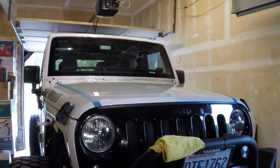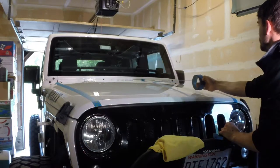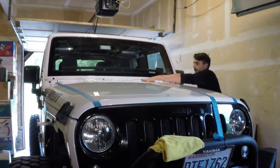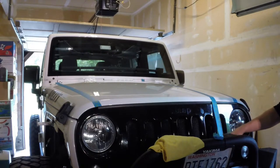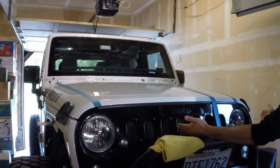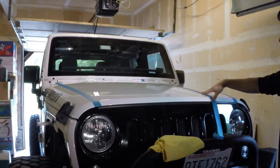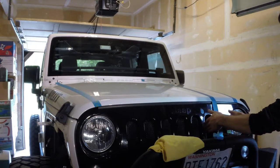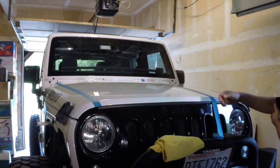I'm going to figure out the stripe I want to put down the front. I'm going to end up doing two wide, and that will continue down the grill. In this part I'm actually going to mask negatively — I'll be pulling this tape off to show the white paint underneath and get rid of the blackout. On the grill I'm going to mask on either side, so it will be the inverse of what you see on the hood.